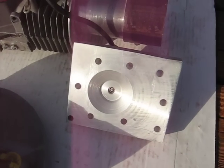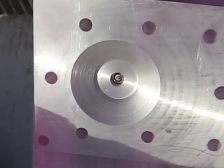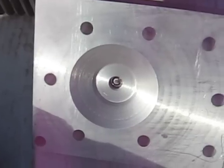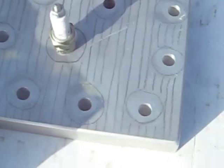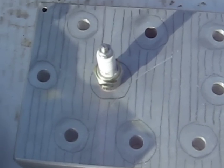Here's our cylinder head for it. Unlike the four-stroke sleeve valve, the sleeve doesn't come above the face of the block. Let's move to the other side. You still have to cut some shallow cooling fins in it.